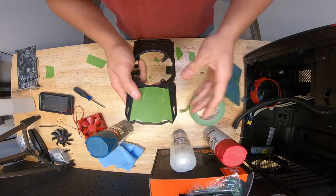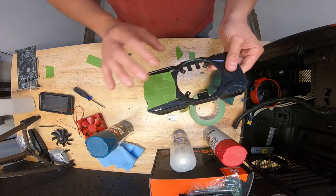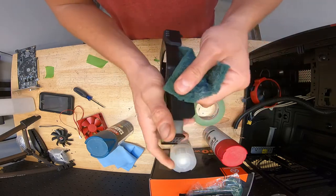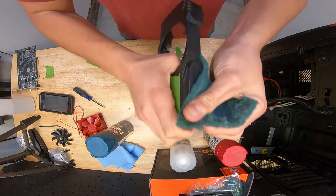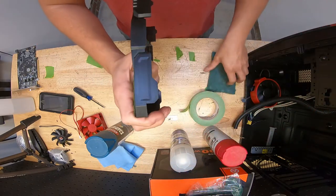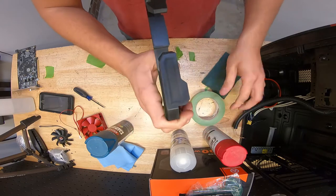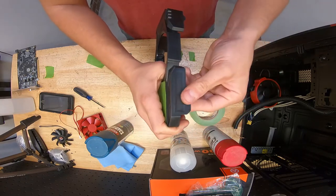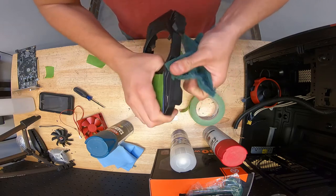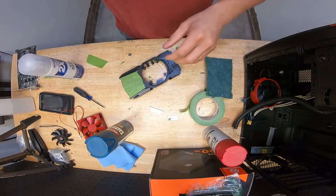I've already taped this off because it has a little dragon logo which I think will look cool with the red. For prep, you take the scuff pad and rub the surface — you can see it starts to dull out and you get light surface scratches. Nothing heavy, just enough to dull the finish. Once it's dulled out it's ready to paint. Keep going until the whole surface looks dull and feels slightly rough.